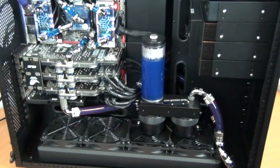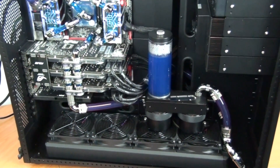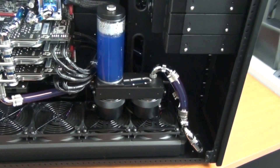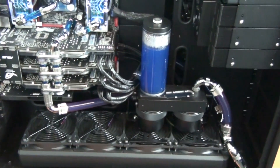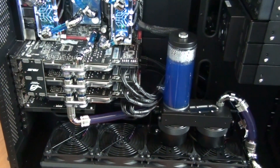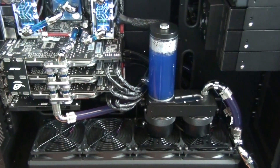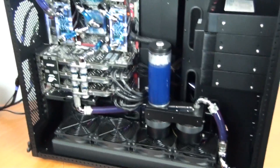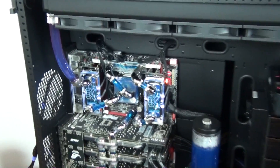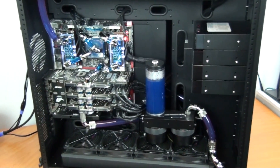I'm going to take you through the process of fixing this problem. Usually flushing the loop with distilled water is enough — not a quick flush, but running distilled water for a few days. I've done that a number of times with this loop, changed coolants, changed tubing, and still the staining hangs around. When staining is difficult to remove there are products you can use: vinegar, isopropyl alcohol, and bleach are a few I've heard of. I'm going to try one of these, running it only through the radiators. The entire purpose of my videos is bringing you information, and this is just another opportunity to do that.